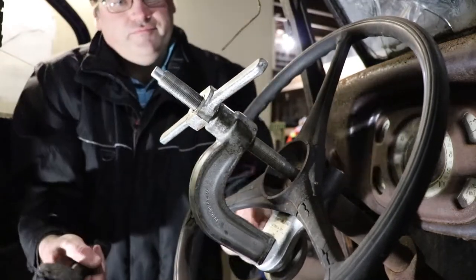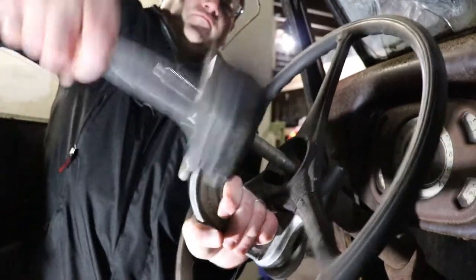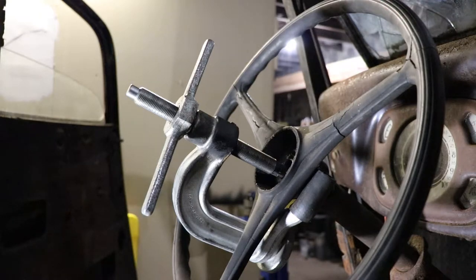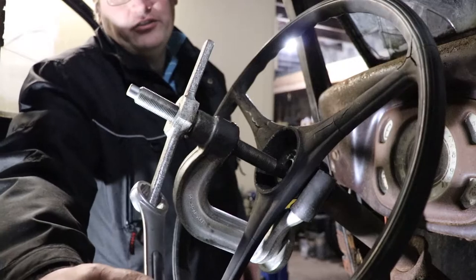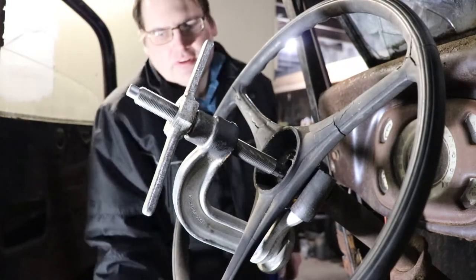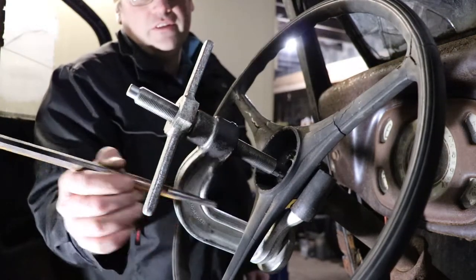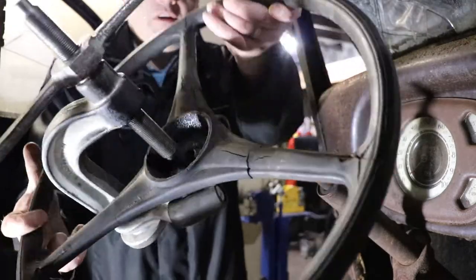Let's just use a lead shot hammer. Might be coming off! All right, so I got it off. It turns out you can't use much heat on this because the steering wheel is flammable. Didn't do any damage to the visible portions. What I did was I used a wrench to put a bit more leverage on it, but I still couldn't get it to come off all the way. So I took a drift and hit around the outside perimeter of the puller to put a little more pressure on it, and that got the steering wheel to pop off.